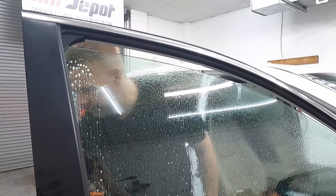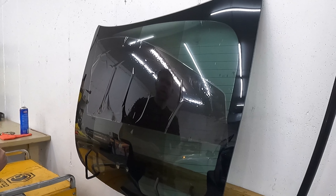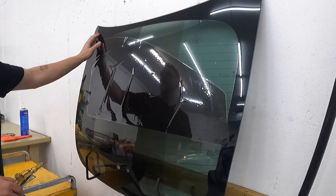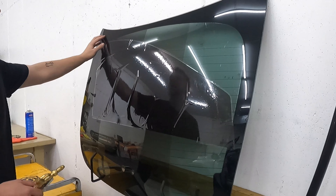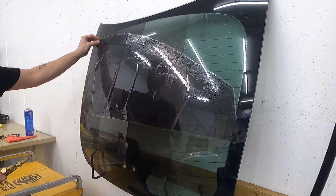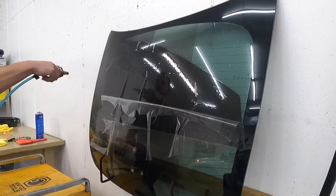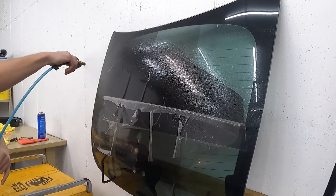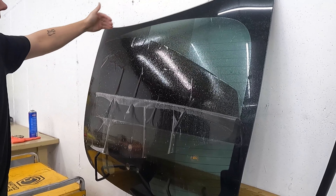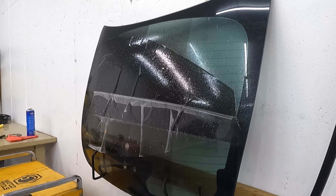Alright guys, so I'm peeling on a peel board — aka Honda Civic rear glass, very convenient. I've cleaned the peel board before I put the tint here to keep any contaminants from running down into the film. So we're gonna spray the air, grab a corner, and peel it down. Don't waste too much time doing this — it's static, so anything airborne can cling to the film. I'm spraying and soaking the film but leaving the top part not so sprayed — I don't want it running back down on the film. It's sprayed and soaked. We're gonna put it on the car.